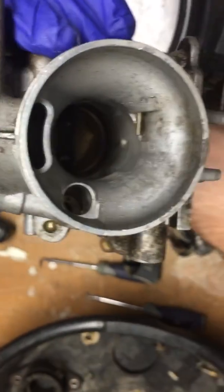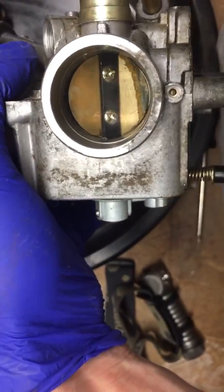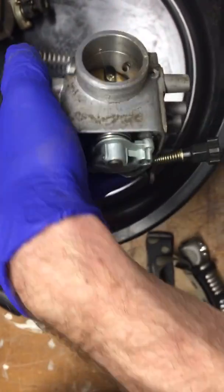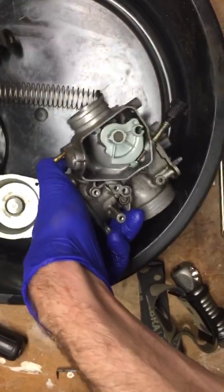As you can see, there's quite a bit of corrosion in the butterfly — it's actually a little rotten. I removed it and cleaned it up a bit. I think this carb should work. I only had one can of carb cleaner so I wasn't able to clean the outside too well; hit it with a brush a little bit but it's pretty caked on.